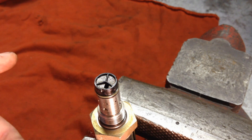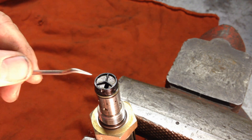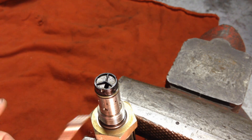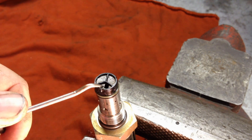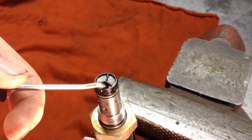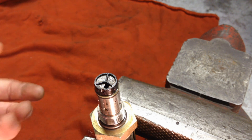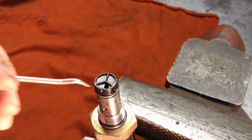I get a lot of questions on the 6.0 liter IPR and what to look for once you pull it out of the vehicle. This one has an obvious defect with the screen torn on it. Many may not think anything of that — just change it out and put new seals on it. But that screen tore because a piece of debris blew past it and got into the actual IPR pintle valve, holding it open.